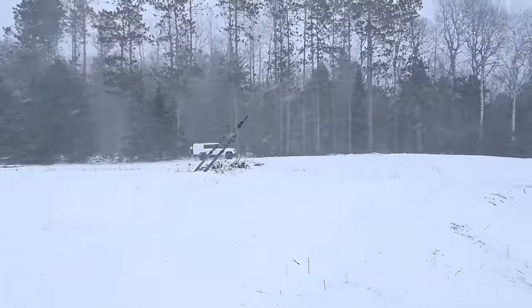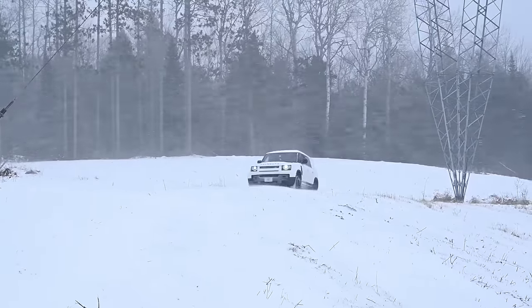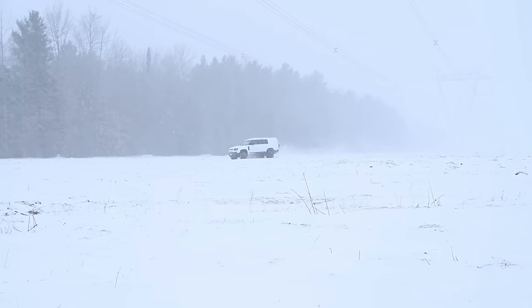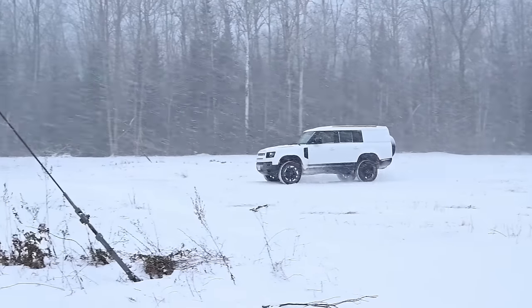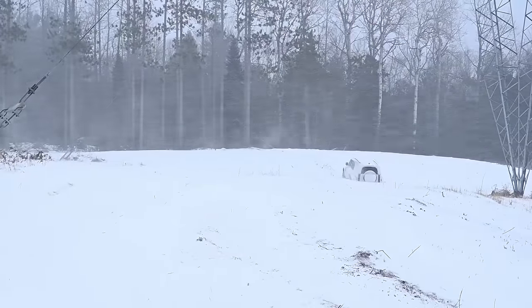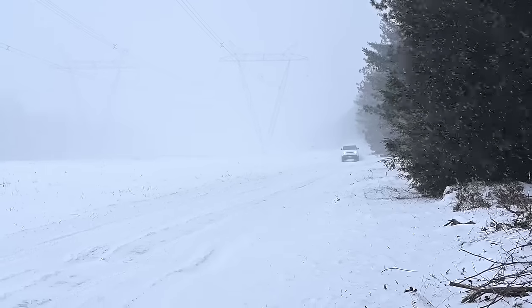It's not a poser by any stretch because it's got the chops — the drive modes and the lockers. But those are useless if you don't have clearance. That is a problem with a lot of vehicles we've tested — they've got the gear, but they don't have the clearance; you're into problems with air dams and fascias, approach and departure. But with this thing, you crank it up and it lifts — I mean, it lifts a lot. Somewhere between four and six inches, and it feels significant. With these aggressive tires, it was fun — having a blast. The one downside of the air suspension is when pumped up it gets a little stiffer and has a tendency to kind of want to buck off of obstacles, because you're using all your suspension travel to bring it up. But that's not really a big deal given the amount of capability you're getting from that lift.